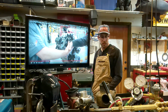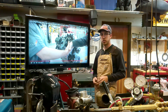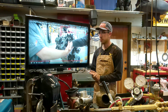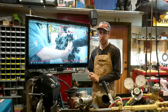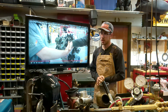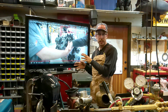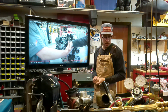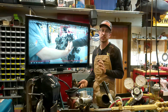One thing we didn't touch on: Chevy used to have Active Fuel Management, which turned out to be problematic at higher mileage — the lifters would stay closed and need replacing. What I've done for customers is just delete it, go to a regular camshaft and get rid of it, because the mileage difference isn't significant enough to keep those problematic parts around. Chevy used to do cylinder deactivation on just four cylinders, but from what I understand, they now do it on all eight — so now you've got 16 junk lifters that are bound to collapse at some point.